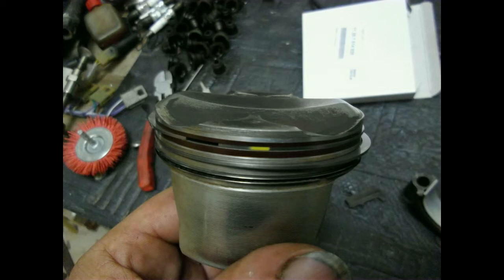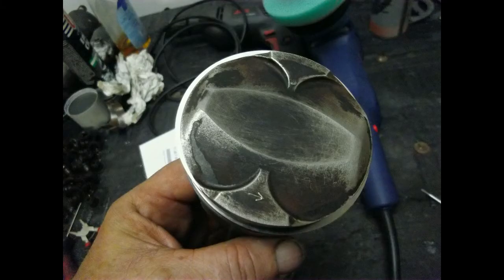As you may remember the lower ring consists of a pack of three. I cleaned up the piston itself as much as I could without damaging it. Note the arrow on the top — it is pointing to the front of the engine and it has to be installed that way. That also makes it clear where it goes when you only take them out two by two, one on each side.